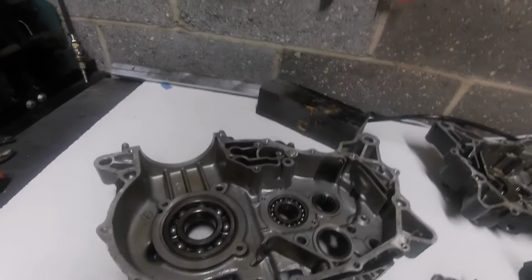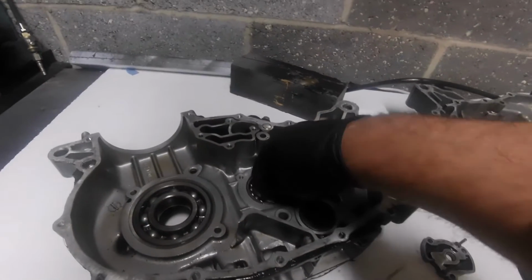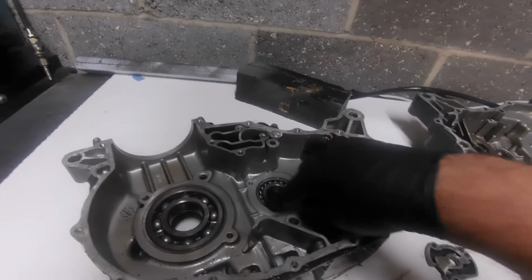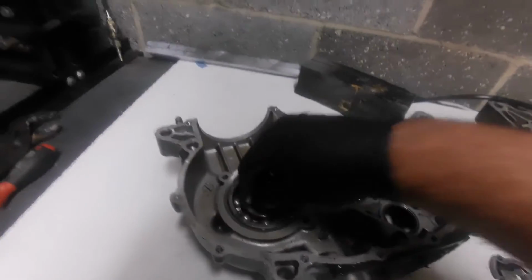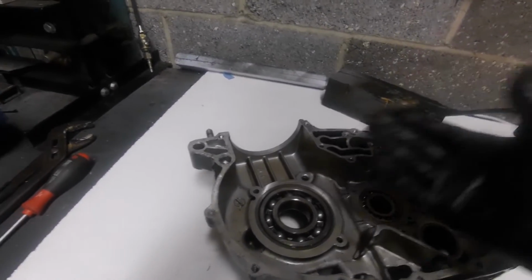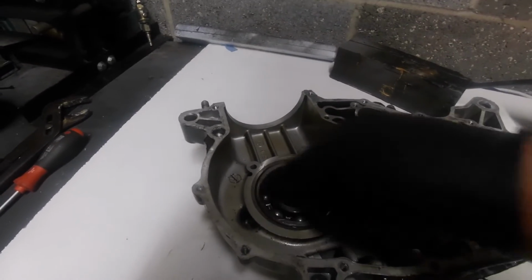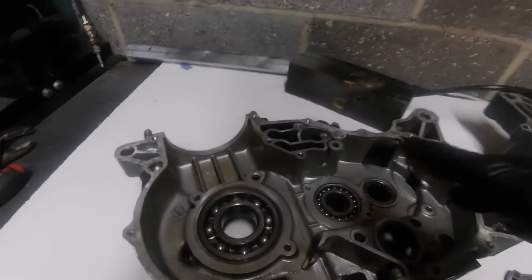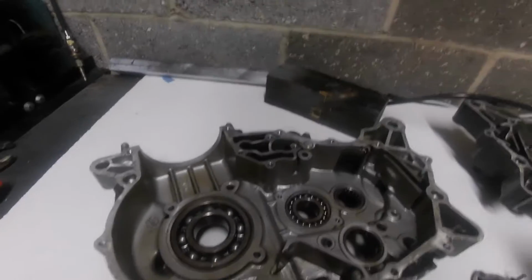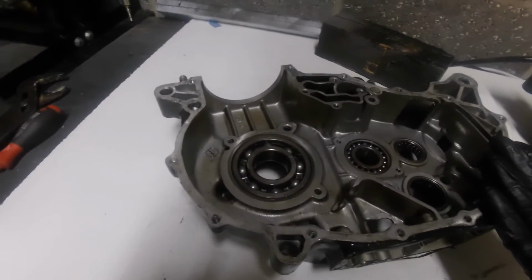experiencing what we've just experienced with a big end failure, it's very difficult to actually pressurise a ball bearing, isn't it, because of all the gaps. You don't ever really pressurise these bearings, do you? Come on, argue it with me. How can you pressurise that with all them holes in? What we get is low pressure, high volume thrown at it, like somebody's chucking buckets of oil at it. That's how it lubricates itself.